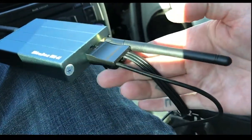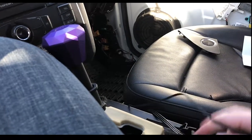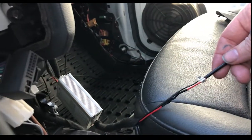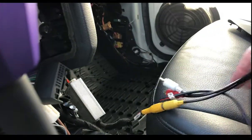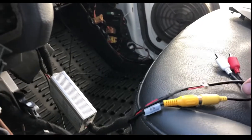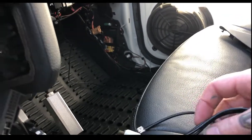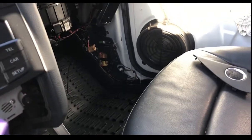Other side, you got the harness. The power side of it, I spliced into the reverse camera — it has a power output on there — and then the other part is the video, which is able to connect into the reverse camera box. And then the RCA's, which I have an adapter to run that to the AMI box, but since there's no glove box, I didn't really feel like doing the wiring yet.